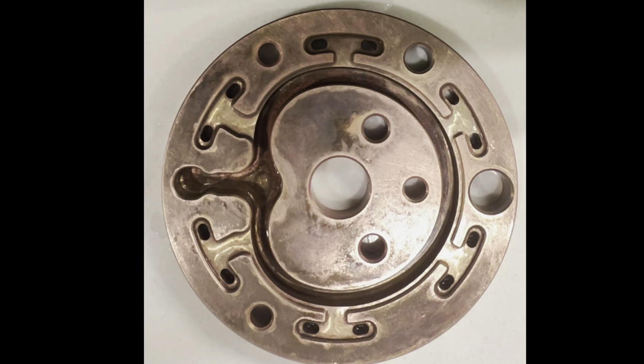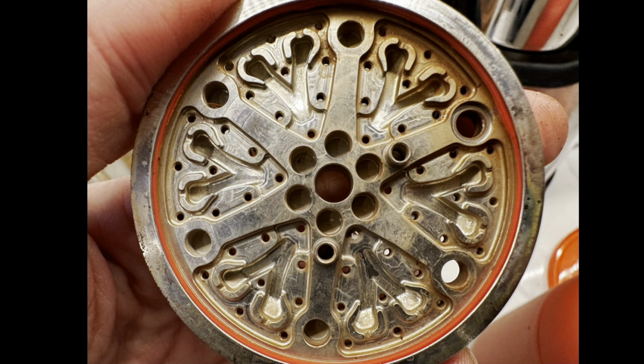This is the Decent water dispenser. In a similar fashion, the water goes around in a circle before it goes into a bunch of smaller outlets, which is a little bit better. It goes into a diffuser, but I'm not certain the diffuser is working as it should based on other data I have. I find this design problematic — there are a lot of variables that are unexplained or unaddressed, like water turbulence. My preference is always for simplicity: water dispensers that are simple and even in how they dispense water.